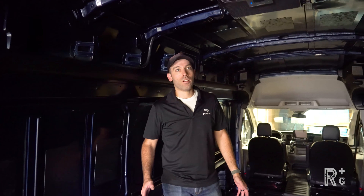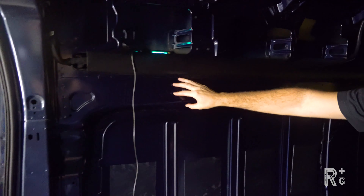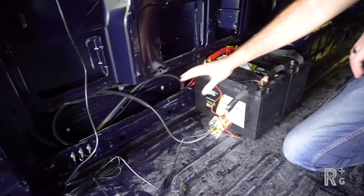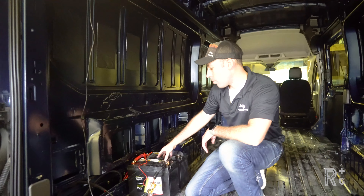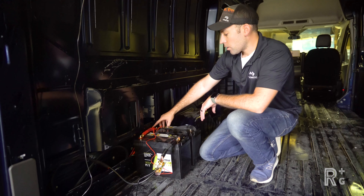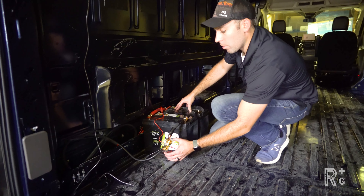We're just about wrapped up with the install. We've got our power cable running over to the roof truss, coming down, across, and into this cavity, then running over to our Go Power Sun Cycle lithium batteries. We have a bit of extra cable here just in case we need it. We're running to two 100 amp-hour batteries wired in parallel. I want to make sure we point out how the power connections are made — the RTX positive cable runs to one battery in the back, and the negative power cable is connected here to the Go Power battery monitoring kit.